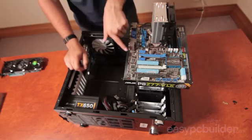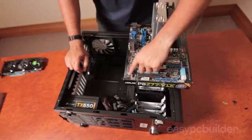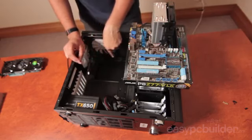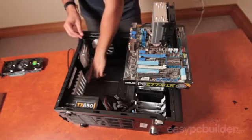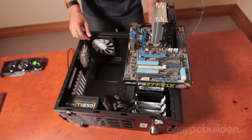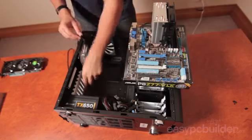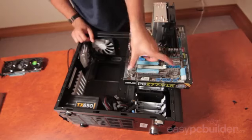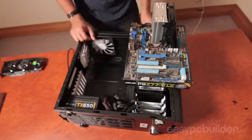Now, looking at the motherboard, we need to find our through-hole mounting points. On this particular board, we have 6 mounting points, which need to correspond to what you install inside the case or what has already been pre-installed. The method that I'm using for determining the distance from the mounting points is the very scientific thumb method. This method works quite well for me, but for a more accurate way to identify the locations, I suggest putting a suitably sized piece of paper under the board and tracing the mounting holes through. Then mount your risers with respect to this.